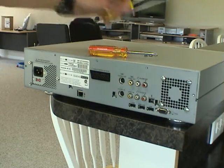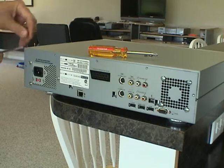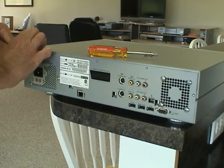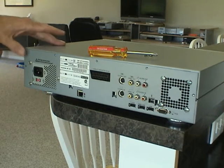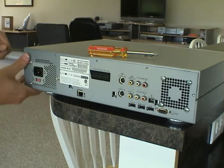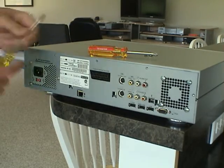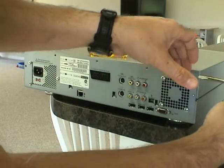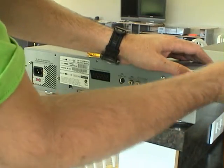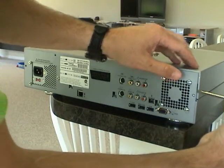The second step to get inside the Prestige is placing the flathead screwdriver in between the back panel. You can just get your fingernails in there, then place your thumb on the back so when you twist it, the top half of the case will go forward a little bit. Then come and do the other side — again, place your thumb on the back panel so when you twist the screwdriver, it will force the top half of the case forward.